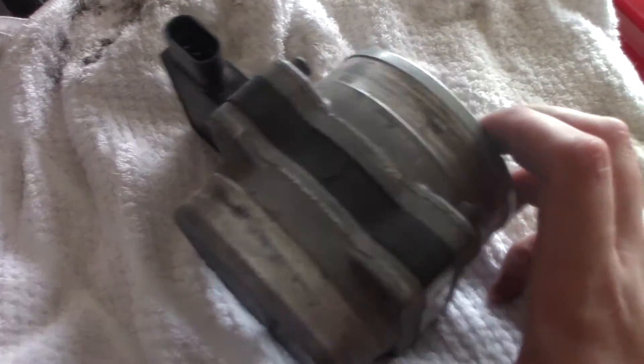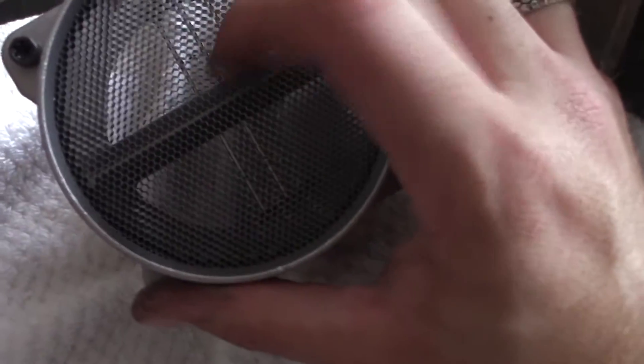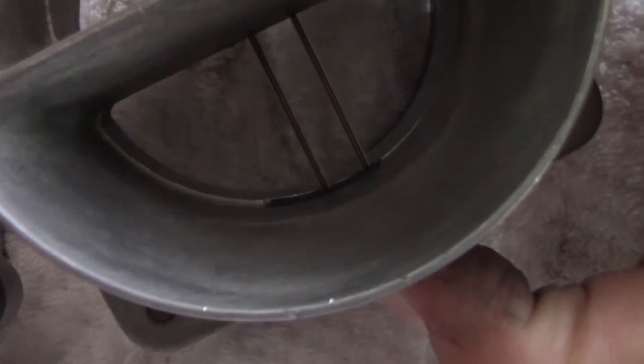As you can see, we've got the stock mass airflow sensor assembly. I'm really hoping this will solve our issue — it's like half the price of even just a house brand sensor from a parts store. Now on the brand new sensor, the first thing a lot of people do is punch out this screen to increase a little bit of airflow, though I can't tell you if there's any real difference. What we notice right away is that on the inside of the old sensor we've got these little resistor-looking things, and it looks like some of them are burnt off — so that could definitely be an issue.